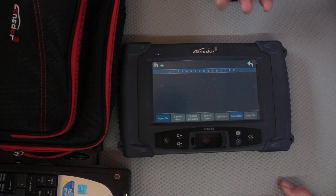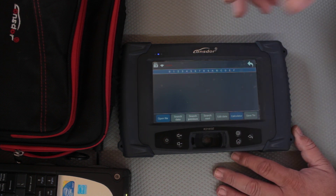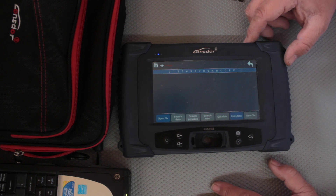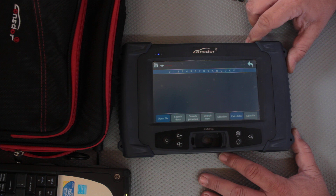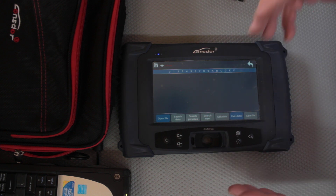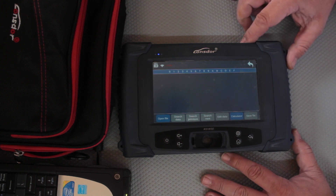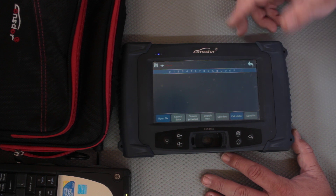Because it's not as simple as just adding the key — you need to add it in the right locations. Some tools actually do add it in the right location, or they can read it and let you put a chip in and just push create, which creates that chip using data from the hex file. My question was: since this tool doesn't have any of those procedures that the Tango or other key machines have, and it does have a SOIC adapter, how do I use it?